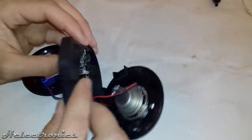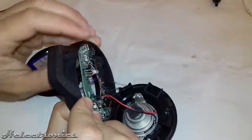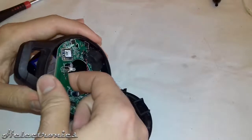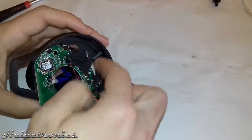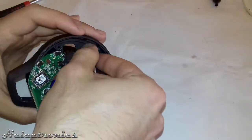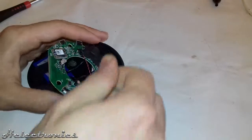To take out the circuit it has to be pressed with force, which can damage the circuit, so it has to be done with care. While the circuit is pushed out, the micro USB connector and the 3.5mm jack are under pressure and can break from the circuit, so it is not recommended to remove the circuit from the frame if it's not necessary.